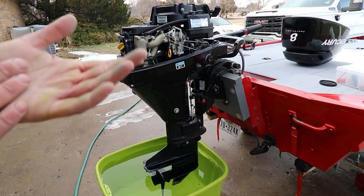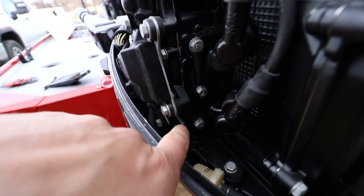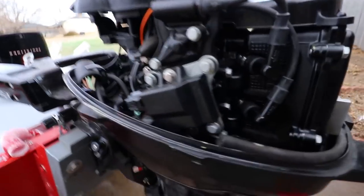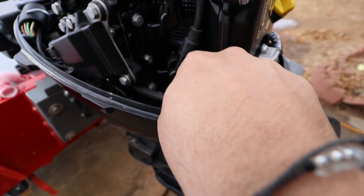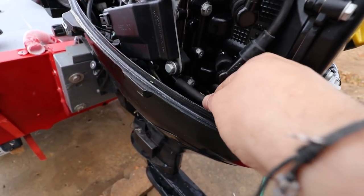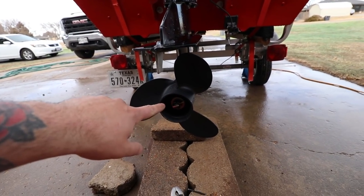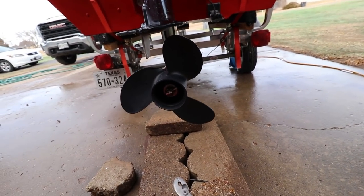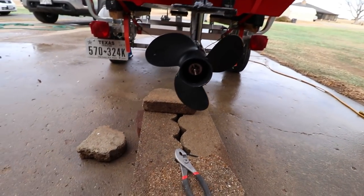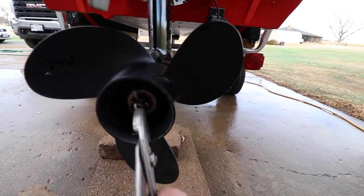It may be a lot of bolts taken out right here just to find out where this stupid clog is. No clogs in the hose. I stuck a little Allen wrench up in there and did not feel anything — so that's not clogged either. That is not good at all; I wish it was clogged because that is super easy to fix. Now I'm going to go ahead and take off the propeller, which I've actually never done before. Get all the fishing line under there if there is any — I'm sure there is. I will have to go get a new cotter pin; all part of the process if you want to get this boat on the water.